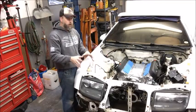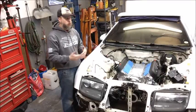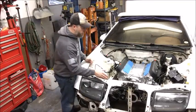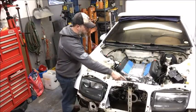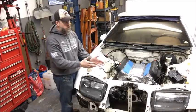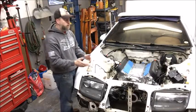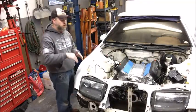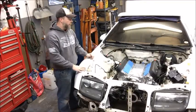So what we're going to do — we've done it on other client cars, and it's what we do whenever we sell a race-style radiator to one of our clients — we have to cut the radiator support out and remove the hood latch and convert to a hood pin setup so that we can cant the radiator forwards and give ourselves enough room to install a 16-inch style fan on the backside of the radiator as a draw-through to cool this car.